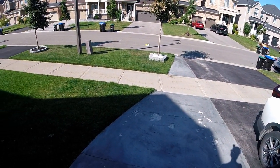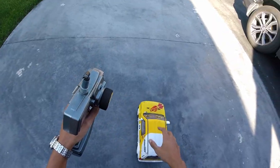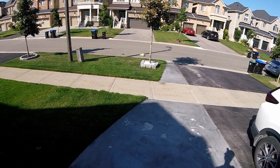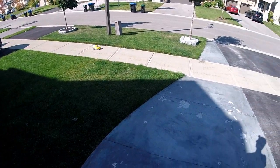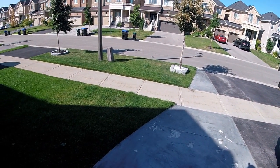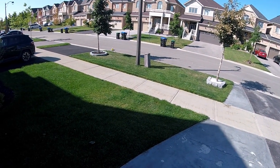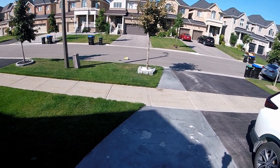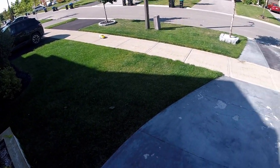Like I said earlier - oh, why is it turning left all of a sudden? Okay. So I've stiffened up the rear end a lot so it doesn't lean as much and can be thrown around better, and I've softened up the front so that it grabs the ground. As you can see - I turn and it's turning now. It did not do that before. Now it's got like a one-foot turning radius, it was three feet easily before.